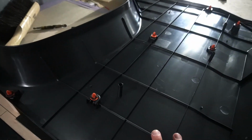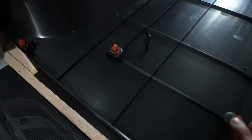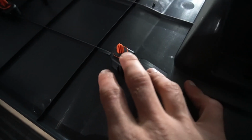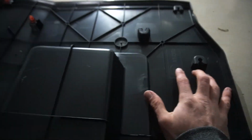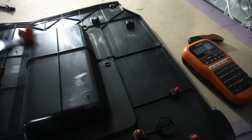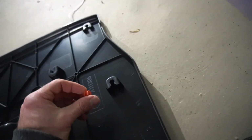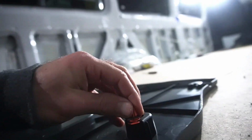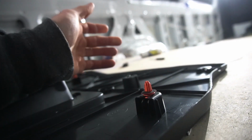Okay, so I'm popping the back panels off the back doors. These back panels are held in by these orange clips. This is if you have these back panels; some of them I know do not have them. This one does. You need your trim removal tools, and then you might be unlucky like I was, and some of the clips just pull out of here. If there are a few left over like this, you need the tool that looks like so. It comes in the kit. You put it in here and just pry out, and it comes out perfectly intact. Then you can pull it out and slide it back in place. Of course this is not going to slide in perfectly while I'm watching it. There it is.